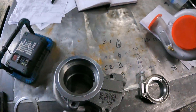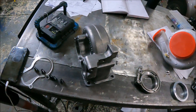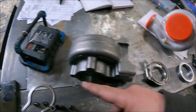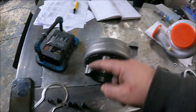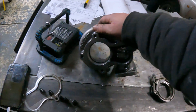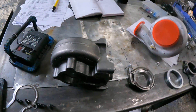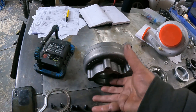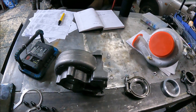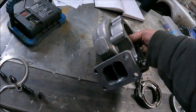That's probably what I would do, like on my 181 — because although you'd never tell by looking at it, the turbo housing I used on that was originally an internal gate. I really went to town and cut off the whole back section, then welded the V-band directly to the actual housing, which is best for flow. I literally cut it right back to where the turbine wheel was and had a four inch V-band from there — maximizing turbo efficiency.